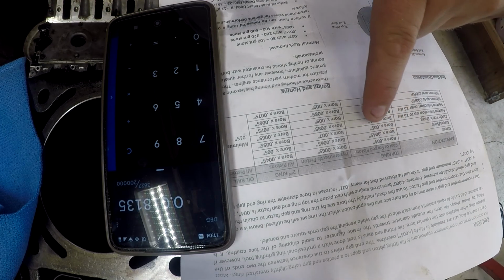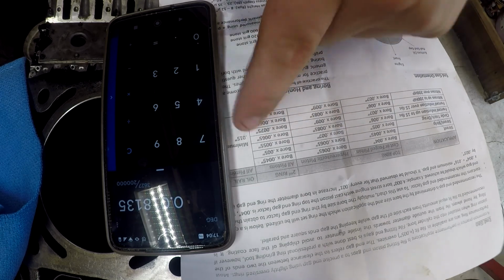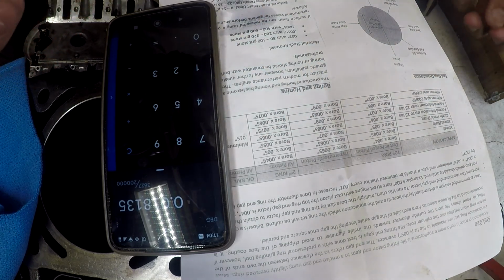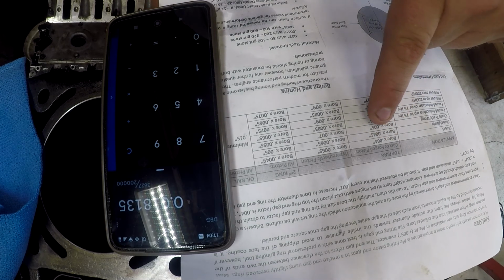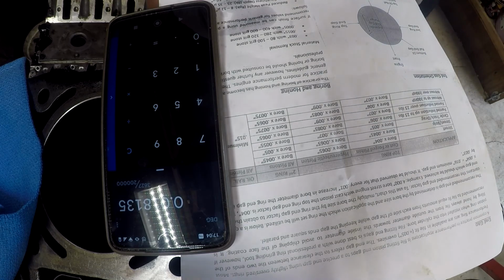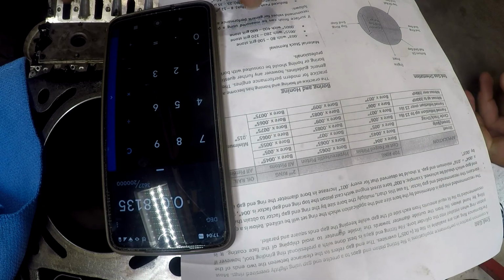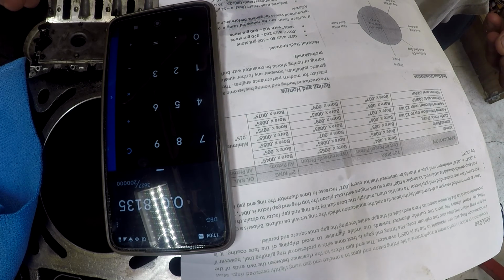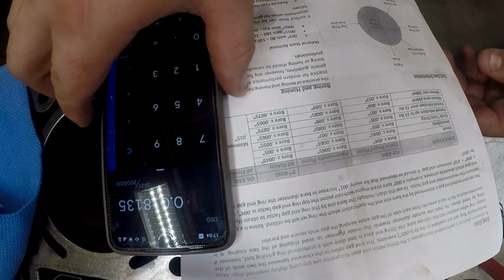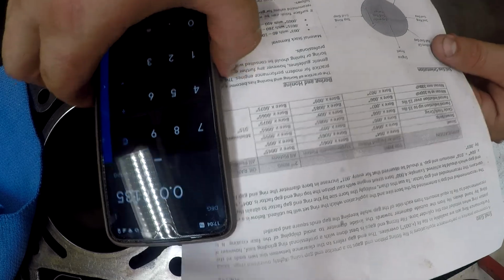For street strip, it's a little looser, so we're actually probably going to go for 17 and 19 thou. I think that should be safe. A touch loose versus a touch tight, because that gives you a little more protection so that they don't touch. So let's pull that one out and let's give it 4 rotations and see where that puts us.